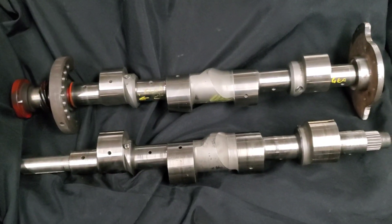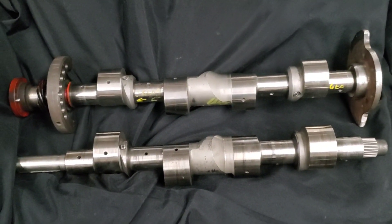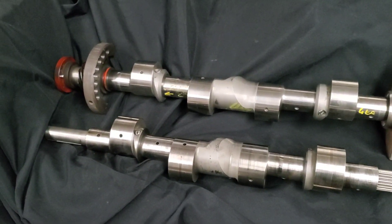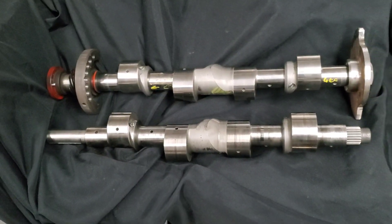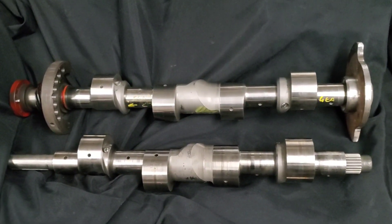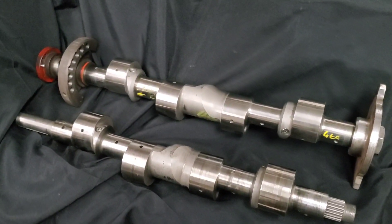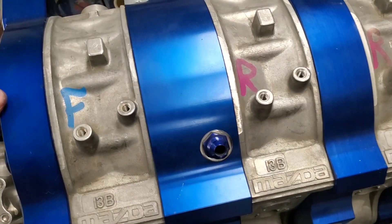You're taking a shaft, adding your bearing carrier plates, and then a lot of OEM parts on top of it. It's great to see manufacturers really pushing the envelope. The modern billet motors have come a long way, and I think as we start to see cast iron parts in the 13B category either grow in price or become less available, we're going to continue to see more and more billet components come out.